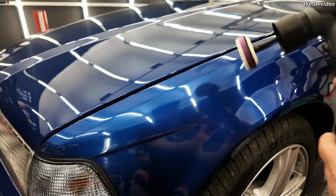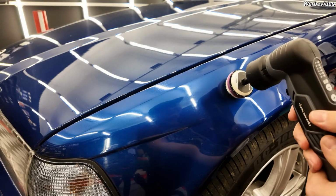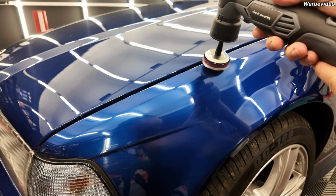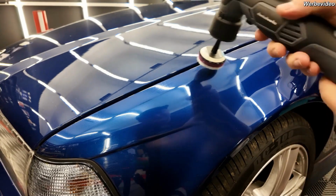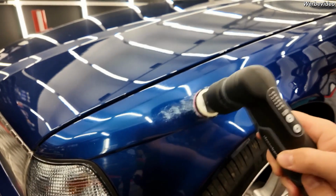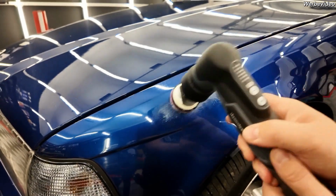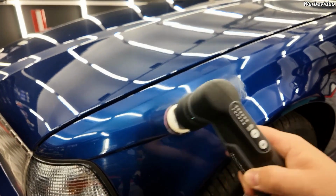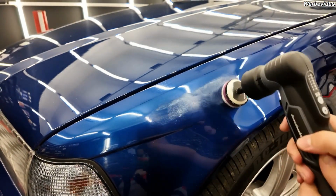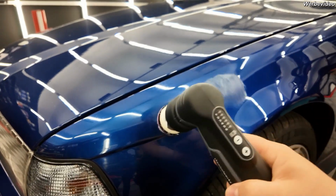Now you go here onto the surface and first choose the point where you will work. To show you this better, we won't start right at the top because it doesn't film as nicely, even though the polishing is exactly the same. Instead, we will work in this area, in this longitudinal direction, as it is simply the best to fill. Distribute the polish a bit. The paint must be clean and prepared. Makes sense? So we have skipped that after the many tutorials and guides.